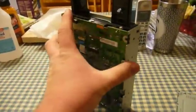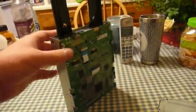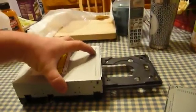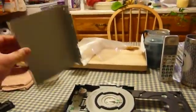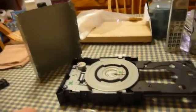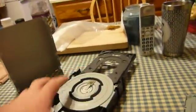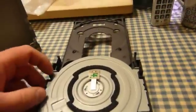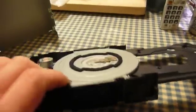Getting the top cover out is a little more of a challenge. Some drives make this easier than others. Some drives it's as simple as placing them down on the table and lifting up. Other drives have some clips or latches, and you might need to carefully splay out the metal cover — but don't splay it out so far that you actually end up ruining the cover and being unable to put the drive back together. This one looks like it might not be much fun to remove; there's a set of clips here, but it seems like there are some metal things there that might make that a one-time assembly.